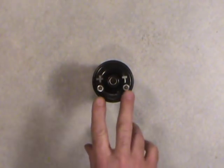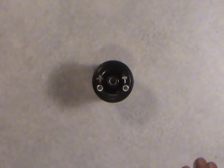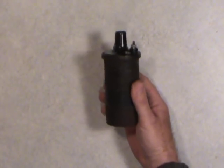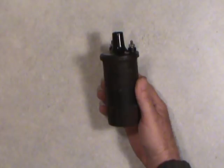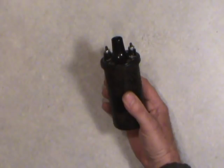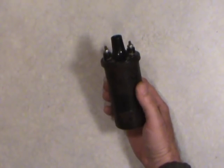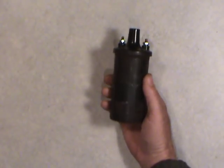What I'm about to do here is show you how to measure the resistance of both the primary coil and the secondary coil. This is typical of General Motors, though this is actually a Chrysler product. Chevys and GM products used these up to about 1974 with breaker points inside the distributor, then in '75 they went to the high energy ignition and the coil-in-cap model.